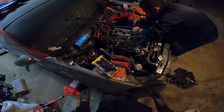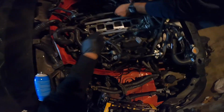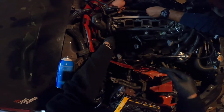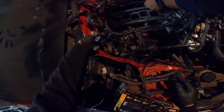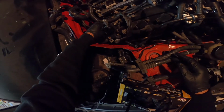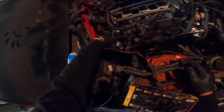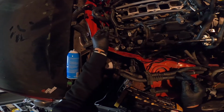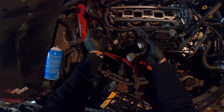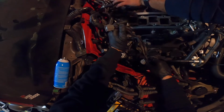We're gonna connect all the injectors. So this would go right here. This is gonna have to go right here like this. Alright, that one's right there. And then you got your cam sensor right here, I believe. This one we're gonna have to relocate because that should go right there. I'm assuming these go up to the top. The throttle ones go to the body. This one goes over here. This is the O2 sensor. I don't know why it's over here.